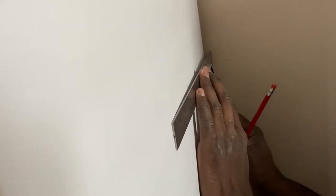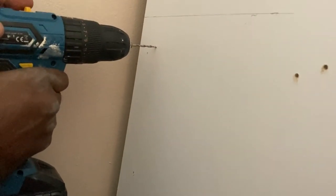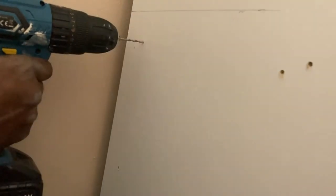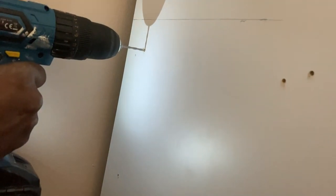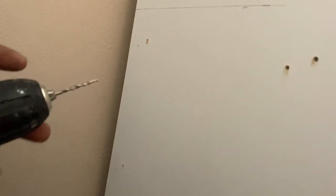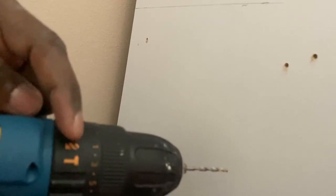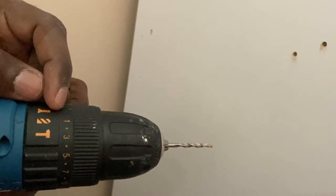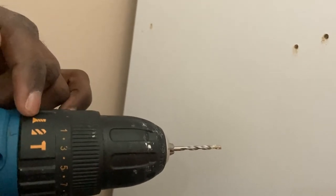So we have to set the position here. We need to drill a little bit of a hole there so it's easy to screw later. It's called a pilot hole. A pilot hole helps to guide your screw into the right place, and also make sure you get your settings right — that you have the setting on the drill for drilling at this point, and the speed set at 1, so it's very slow speed which I can control.